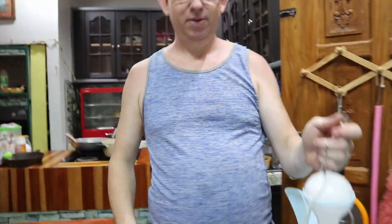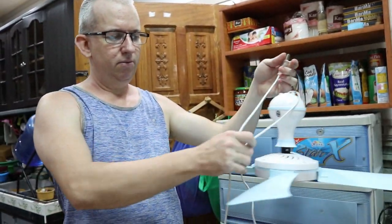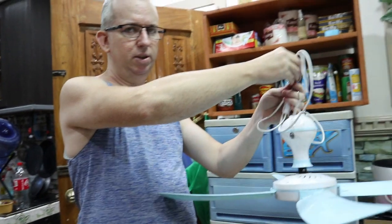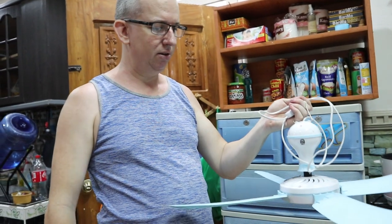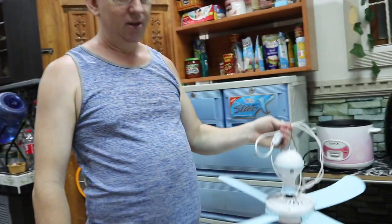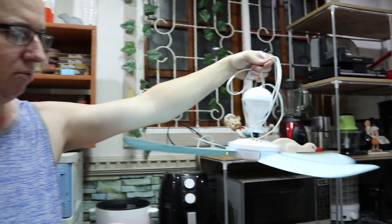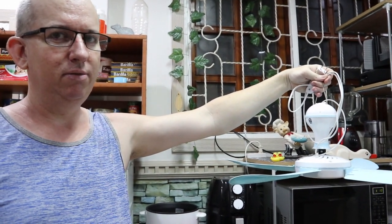Yeah. If you have a broken fan but the motor still works, there's something you can repair in there, right? Yeah, the motor worked, but it just won't spin. So we just took it apart. And when we took it apart, that E-clip fell out. It was just broken on the end. It just fell out. And I was thinking, damn, an E-clip. So that's it. Fix the fan, simple, easy. Runs on magnets. Safety fan.